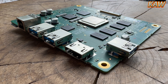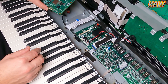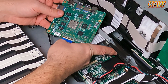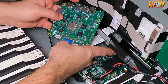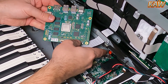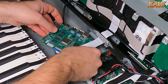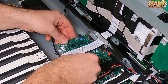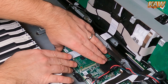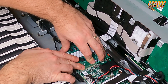Now let's focus on installing that main board back into the PA5X. First, I'm going to connect that ribbon cable and then push that tab down — this way the ribbon cable stays locked. Slowly feed that board back in, and now I'm going to push down on that bottom right corner to make sure it connects to the board below. There you go.